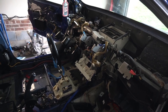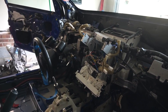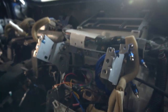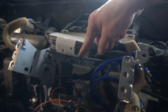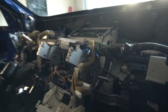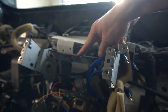Okay — that took about two hours to get out of there. Everyone I talked to, everything I saw online said it's super simple once you've done it once or twice. But on mine, this little nut right here had a bracket from the venting bolted to it, and that was a pain in the ass to get to from back there. Once I got that out, the whole dash came right out — that was the only thing holding it in the center. Got that tiny bolt out and out it came.